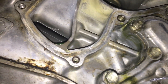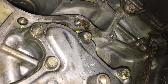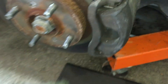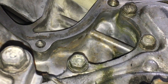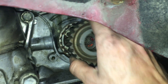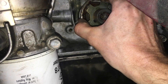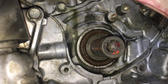Look at the area where the seal was around the perimeter of the water pump — that's a lot of corrosion. No wonder it was leaking. I've got to clean that up. I've been scrubbing away with this scratch pad and it's getting better, but I've still got a lot to clean up. I see I still have some grime behind this pulley — you can just slide this right off. Notice these guides are beveled on one edge; the beveled side faces the belt. Now I can clean this up.